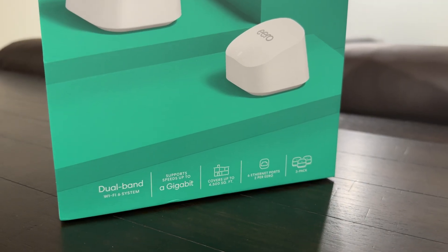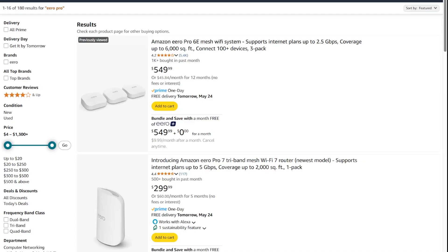For this video and my house, I went with the Eero 6 Plus 3-node pack for $225. Each node can cover up to 1,500 square feet, and my house is about 2,700 square feet. A mesh Wi-Fi network is a network of nodes that connect to each other to strengthen the network, instead of all connecting independently back to one home base. One thing I learned: while adding more nodes may strengthen signal, speeds will be cut down with every node added — maybe even halving the speed. I went around with my phone and Fast.com to measure speeds, which ranged from low 100 Mbps to around 750 Mbps closest to the router.